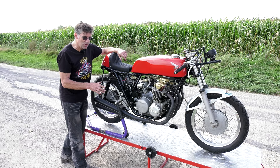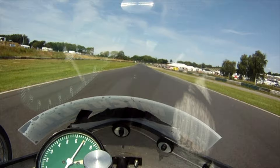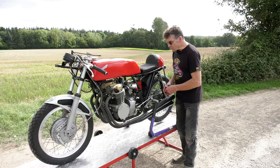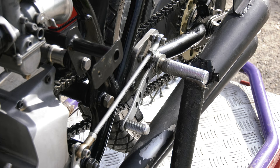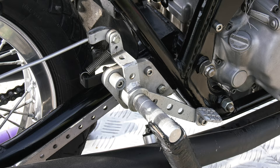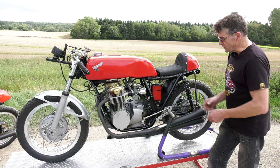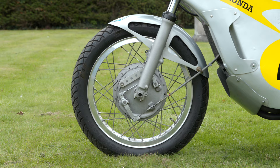Having rear sets, they've got to come in the right position. There's a bracket behind which we can bolt to. So that's a bit of a challenge because you have to weld a bracket onto the frame, which is behind this aluminium bracket you'll see here. So rose joints, linkage, some steel — mimic these parts. In that case I spun some bits up on the lathe and made all the spacers on the lathe. So it was getting this linkage to work properly with the foot.